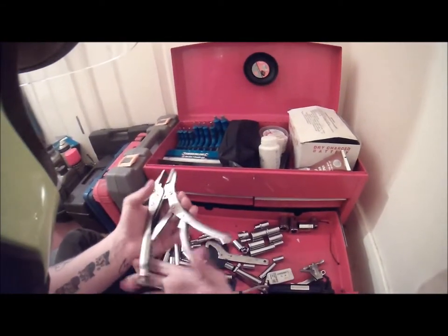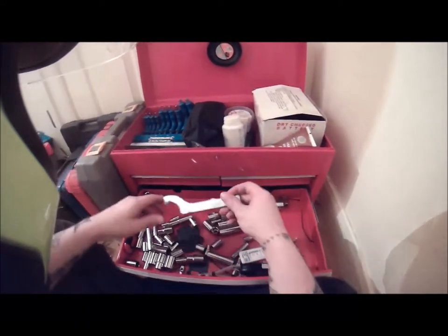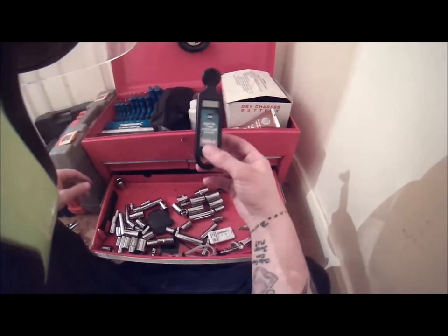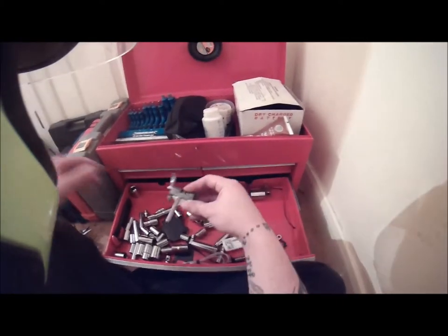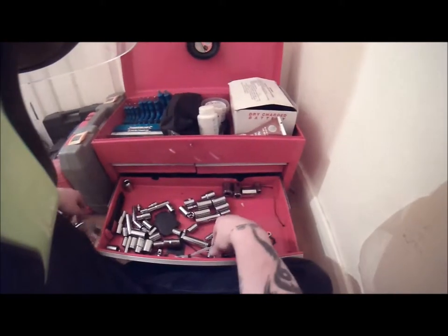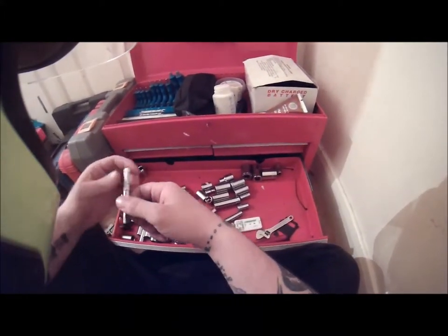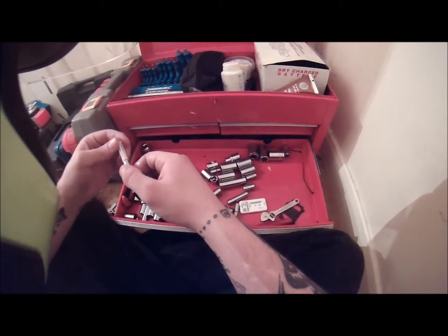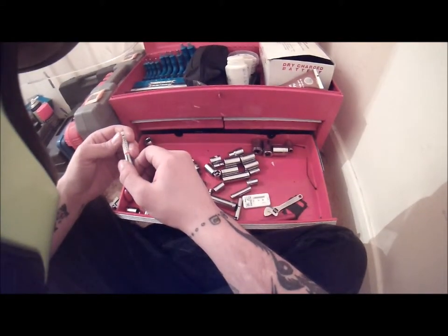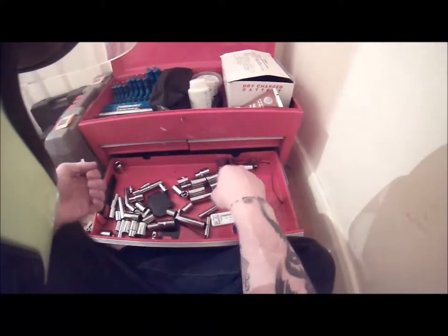These are the beasties. I have a lock, an adjustable lock, a C-spanner, and when you have the lock extension — digital pressure gauge, tyre pressure gauge, chain link remover, cable ties, a tyre tread depth gauge. At 1mm you need to change the tyre, at 2mm start thinking about changing the tyre.